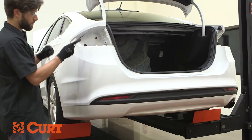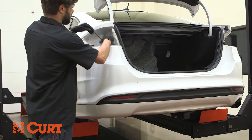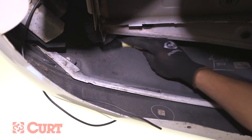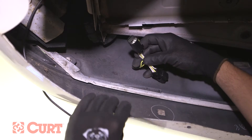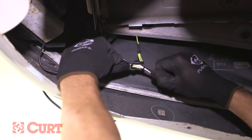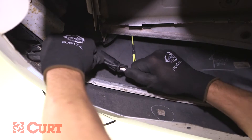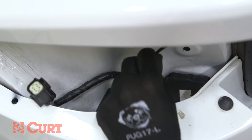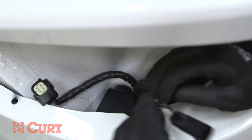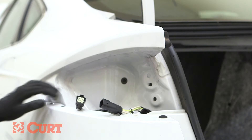Using the included power wire as a tow rope, route the black power wire down through an access hole in the tail light area and out to the bottom of the vehicle. Use the power wire and tie a small knot around the Curt wiring harness and the connectors. You will then pull the harness up through the body of the vehicle and out through the tail light area. To make it easier, assist the connectors as they travel inside the body of the vehicle from underneath. Once you route the Curt wiring harness and connectors up through the tail light area, remove the power wire used to retrieve the Curt wiring harness.